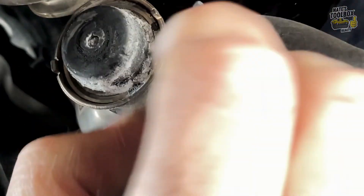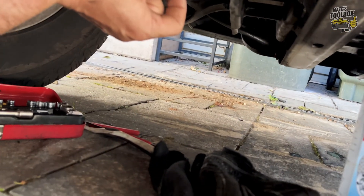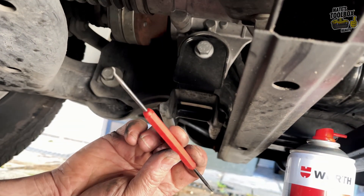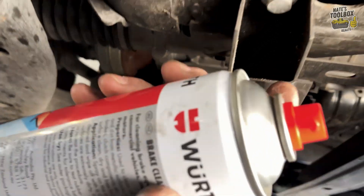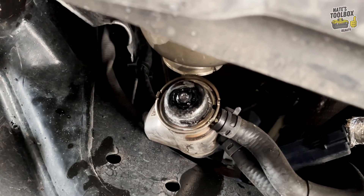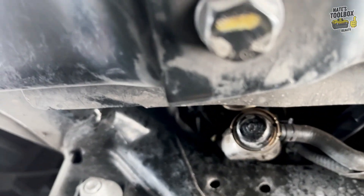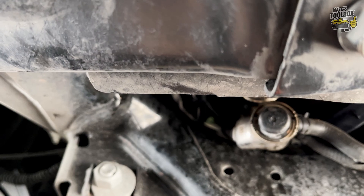Yes, that is full of carbon and crystallized AdBlue — it should be a nice brass color inside. We need to clean that up and we should be back in business. I'm going to use some brake cleaner. I've got a toothbrush, a nice soft brass-bristled brush, double-ended, and a small pick just to get stuff out of the end of the nozzle. Wear eye protection — give this a squirt with some brake cleaner and let that soak in. Now we'll give it a scrub with the brushes and get that pick in there to see how bad it is.